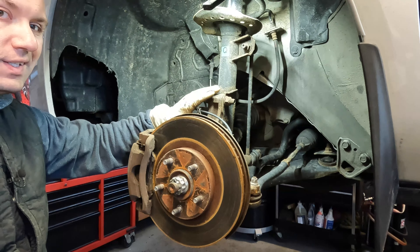It gives us a little bit more room so we can get our tools in to get our bolts off. Right where the axle is, underneath, you have one 21 millimeter and a secondary 21 millimeter. You'll see they're on the forward bushing that holds the control arm in. These can be quite stubborn — I always find these are the bane of my existence when doing this job because getting them in is probably the worst. Now, this forward one is usually not that bad — you can get a 21 millimeter in there and just blast it off.